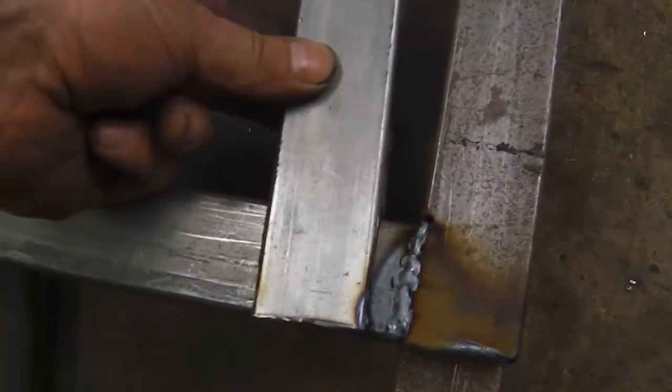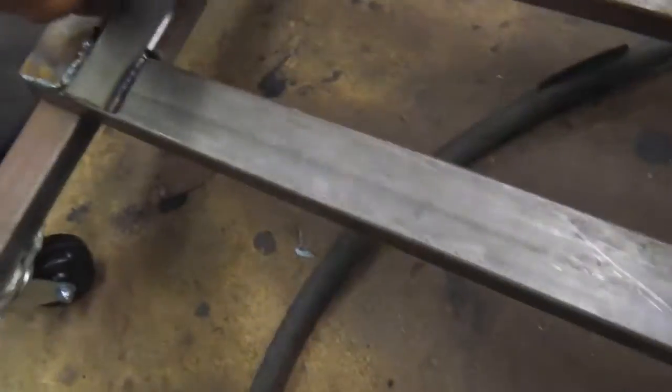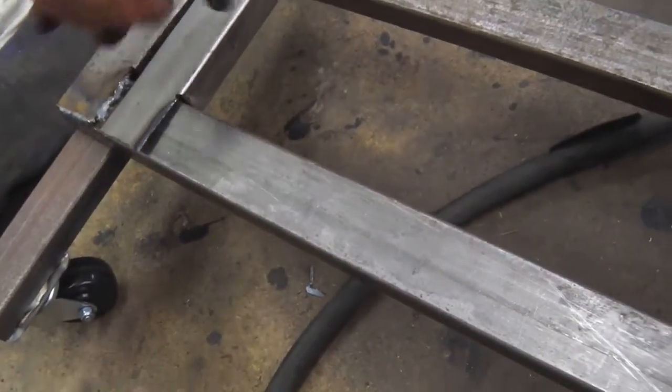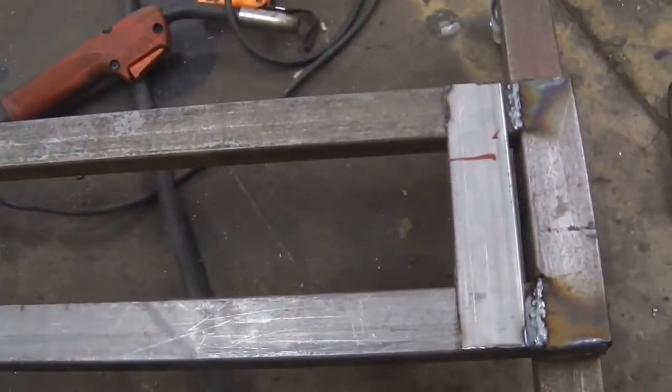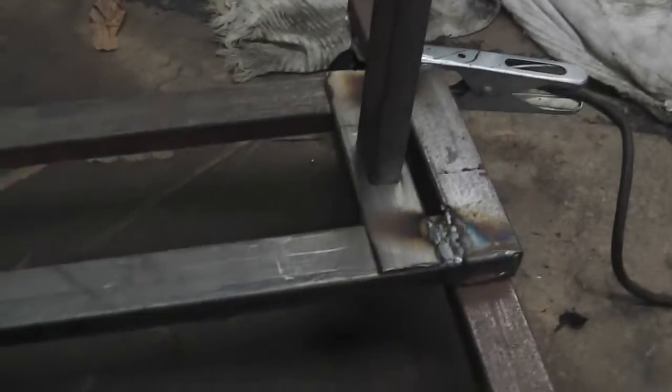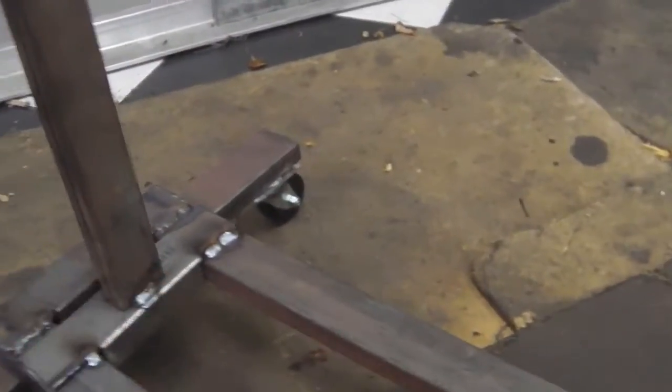Nearly done now, these are just the movable plates, so you can get the exact position between the subframe there. So that's where the verticals will rest. Just weld them up now and we can set the verticals in position. That's the spacing done. Those infill pieces in give us the exact spacing for the front. What we've got to do now is weld up, spin it upside down and get that strong in the middle, and then we're done.